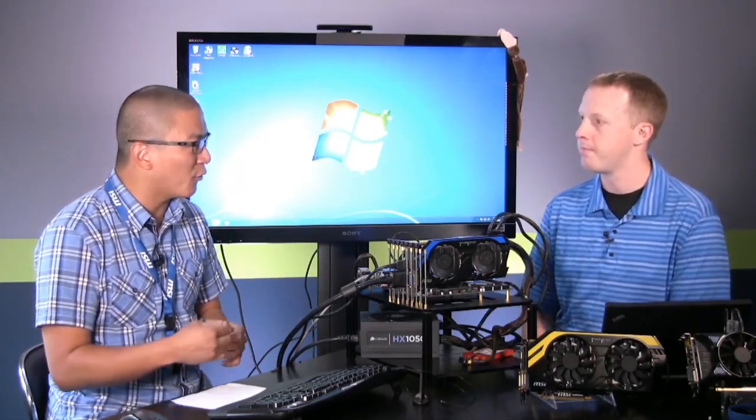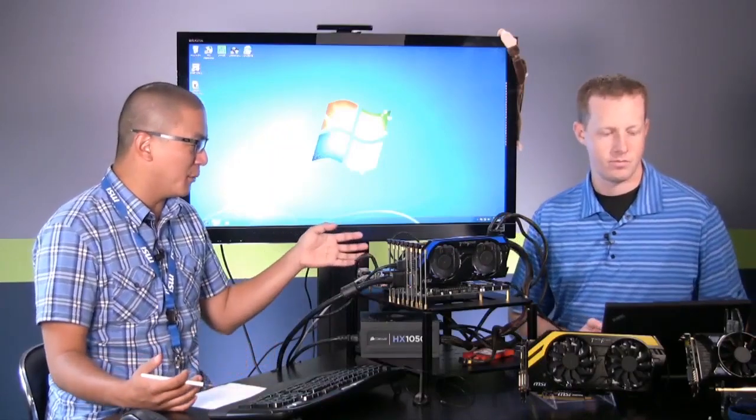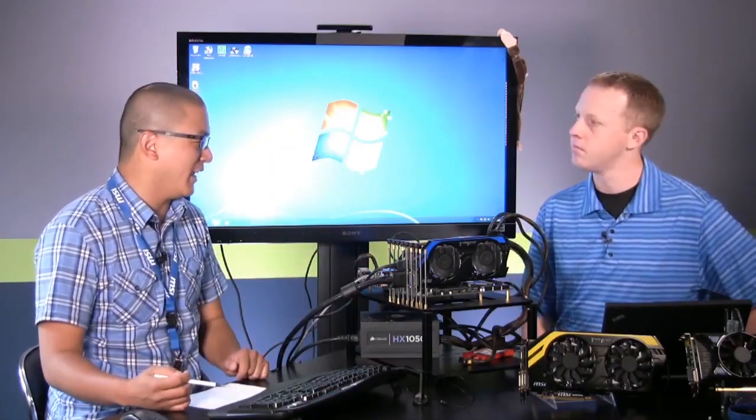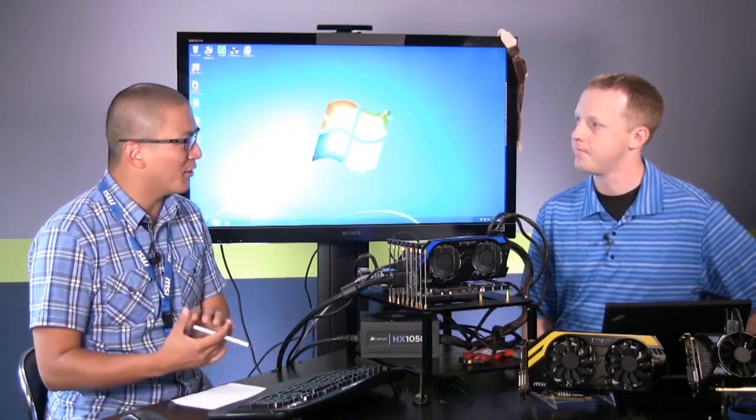But one of the things, and this is at least my opinion, is that CPU performance nowadays is very consistent. It's not like before, where extra power stuff makes a bigger difference. Nowadays it's very easy to do a fairly aggressive overclock, and the performance is pretty consistent across the board. There's not a variance in the overclock ability. You could have a 12-phase board CPU power, for example, or you could do a 68-phase, some random number, right? And all you're doing is increasing the cost of the board, but you're not really getting that much more overclocking performance out of it.